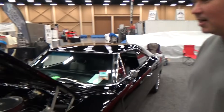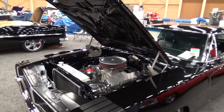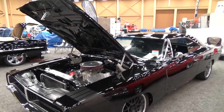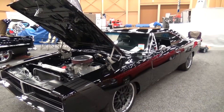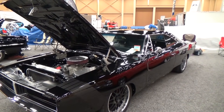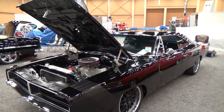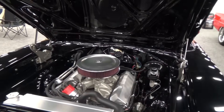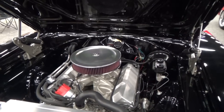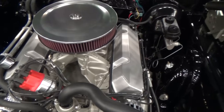Not too bad. Tell me a little bit about this hot rod. Well, 69 Dodge Charger, we put together back at the shop. We stroked a 400 engine to 512 cubic inches — that's a 400 Chrysler motor. Like Chevrolet made one, they made one too. Their big cars came with 400 blocks in them and they sell a stroker kit for it. It's a 440 stroker kit in the heads and we got a billet specialty pulley system on it.